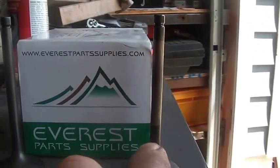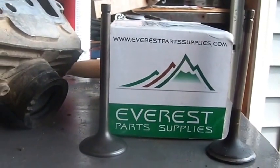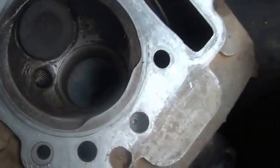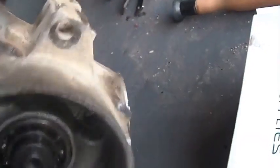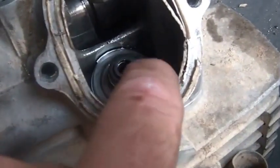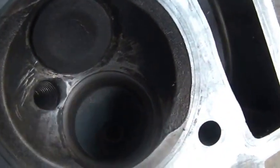I don't know if you can see as I shine this — this valve goes up and kind of goes out a little bit, and that valve doesn't, when you compare it to the edge of the box. So this is obviously the bent one. What I did is I took it out and inspected it — I saw no cracks around the seat or anything, no damage. The valve guide has the little rubber oil seal on top, and once again no damage around it that I was able to detect.